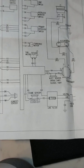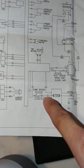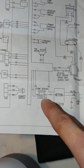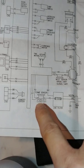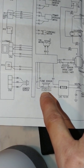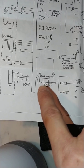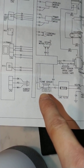Following the circuit with a visual inspection, I saw that this flame sensor had red and white-red-gray colors, which might help you identify it. This is a thermostat — the circuit remains closed at ambient room temperature, and if it senses fire or increased temperature, it breaks the circuit so no electricity goes to the rest of the components.